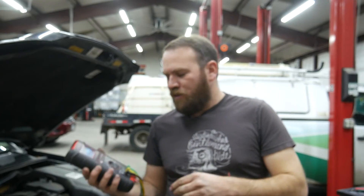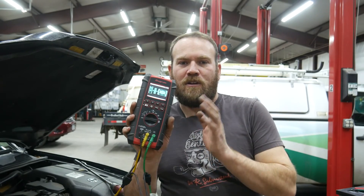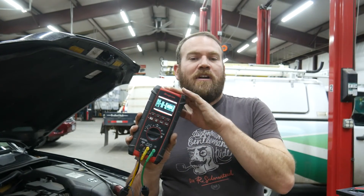That wraps up the Verdict M2 portion — it was cool to use the old wireless scope meter. The Zeus gives you a lot more accuracy: you can zoom in, move the waveform around, and find exactly where your signals are. Plus you can save waveforms on the Zeus — there's no memory card in the standalone scope module. One benefit of the M2 is you can use it as a voltmeter independently without tying up a scan tool.